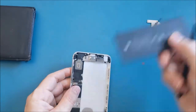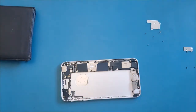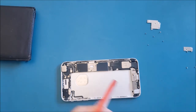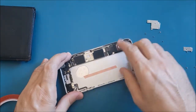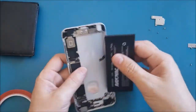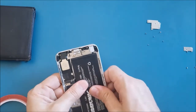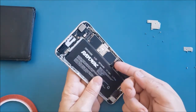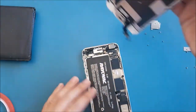The battery is now released. Before putting the new battery in, we're going to place a strip of adhesive inside to stop the battery from moving. Let me cut this strip and place it in the middle. This is the new battery — I'm going to connect its cable first, then let it sit down. Now I'm disconnecting the battery again to finish the remaining work and ensure it aligns correctly with the connector.